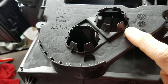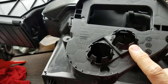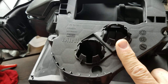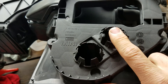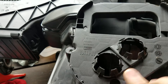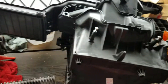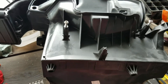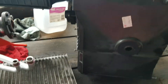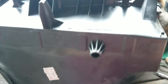It won't come off easily — you'll need to slide the rubber gasket back. These little clips: just take a screwdriver, get one over the lip, hold it, then get the next one over the lip and work your way around. So this piece comes off like that.